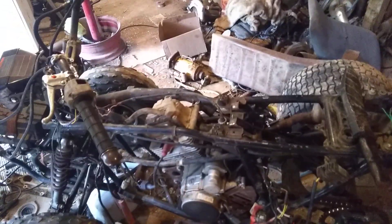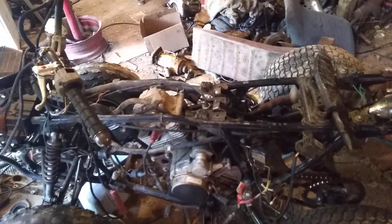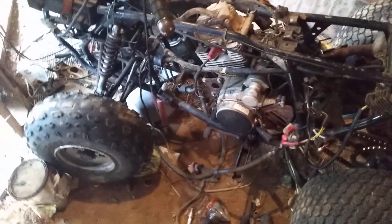Other than that, I've actually been riding it a little bit. I took the gas tank, put acid in it, cleaned it thoroughly so it's functioning. Got the seat on, cleaned the carb, and I've been riding it around for a day or two — then came out to fire it up and it wouldn't do anything. I also wired up a little turn signal light on the back so if it's dark somebody doesn't hit me. A little janked up but I want to make sure it's fully functioning before it goes into the cart.